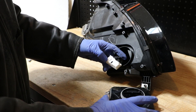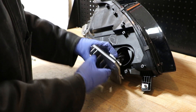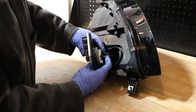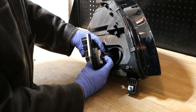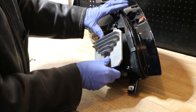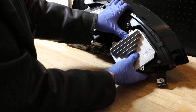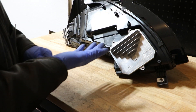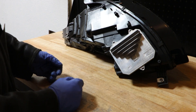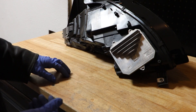To replace the ballast, you need to put the wire connector back in, push it down until it's snug, and then take this wire lock and push it down until it snaps into place. Once done, realign it and push it back into place and replace your three T20 screws. That's all you need to do to replace the ballast.